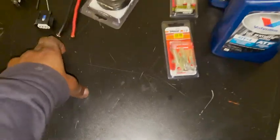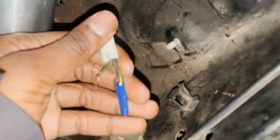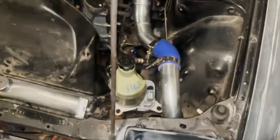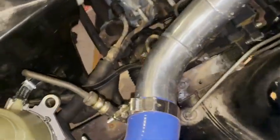For the other connector, this blue wire actually tells the pump to turn on. Since I removed the trailing coil, this black and yellow wire gives it switched power, so I might use that. The wiring is pretty basic, though there's a lot of confusion around it.